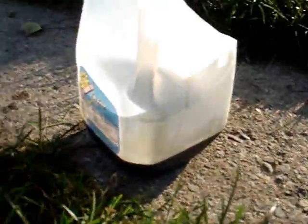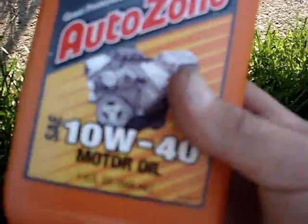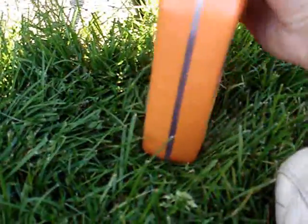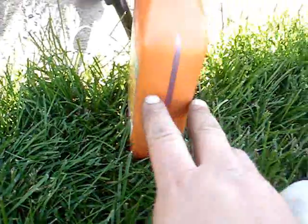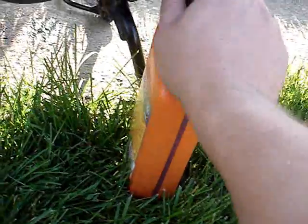I'm not exactly sure how much oil came out of here — I'm guessing close to a quart. The manual told you to use 10W-40 oil, so that's what I'm going to be using. I'm not going to add the full quart; I'm just going to add just a tad bit under just to be safe. Let's add the oil.